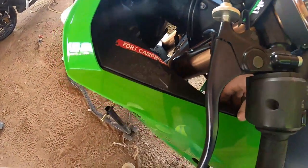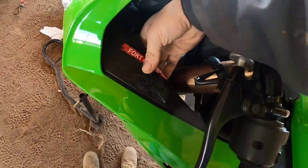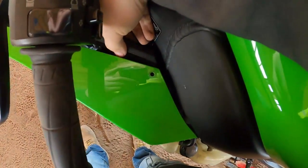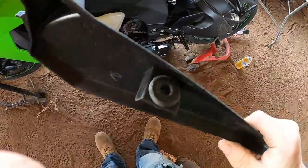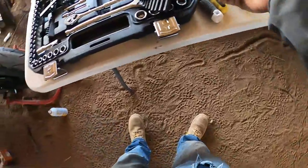I took those little plastic pieces out. These little rubber threaded boot things set inside this piece of plastic, so you've got to be gentle and pop them out. That's what we're trying to get to — this is where the turn signals plug in. You undo those two clips, press on this, pull it out — it's very difficult, probably can't do it with just your fingers. Then you can move them out of the way and pull the mirror straight off. Same thing with the other one.